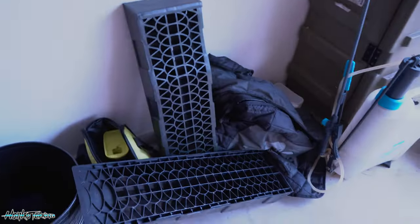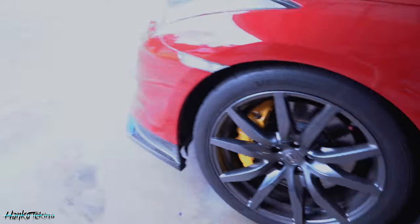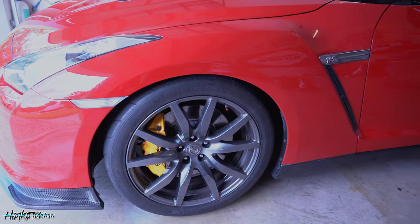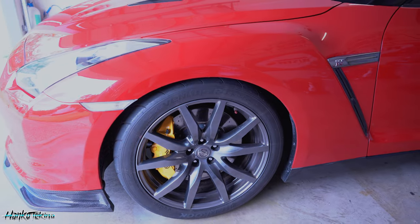All right, now the GTR's in position. I'm going to get these ramps somewhat under the front wheels. I'll crack the studs first and get the wheels off. While I'm under there, I'm going to give the brakes a really good clean. I was watching a few other videos on YouTube on doing a how-to, and I found that a lot of them were struggling to get bolts out, the pins out — clean them. Clean all that brake dust off, and it'll probably make it a little bit easier. That's the first tackle: giving them a good clean.